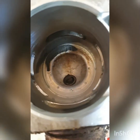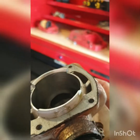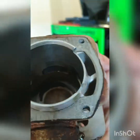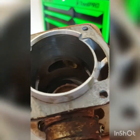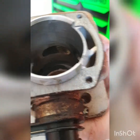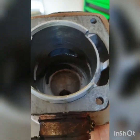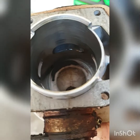I'll tell you immediately what I run: a fully synthetic two-stroke oil, like Husqvarna's LS+ or equivalent. I run 200ml of two-stroke oil to five litres of petrol.